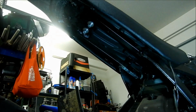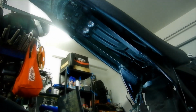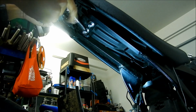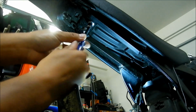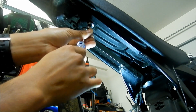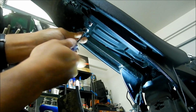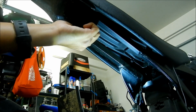The seat out. There's these 2 bolts here. They look like they're 10 mils. Go ahead and take those out. What you gotta do is just loosen these 2. So I'm gonna loosen them with an open-ended wrench and a combo wrench. Just loosen, and then you can use this guy to remove it the rest of the way. It's like kind of a screwdriver type bit, or screwdriver 10mm type thing. And that looks like the fender is sandwiched in there a bit too.